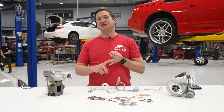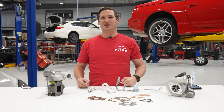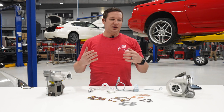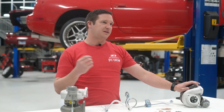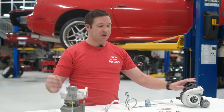That means orders filled faster, no core deposit, no core return, no waiting around to see if you send us ones with broken studs — there's not going to be a problem. For us, it's also simplified our ability to serve, and we know that we're sending out turbos that have fresh, full life on a turbine housing. It's not going to have something like hairline cracks around a wastegate port that could compromise performance at the far reach if you're going for a class record.